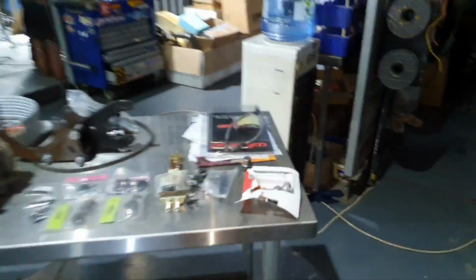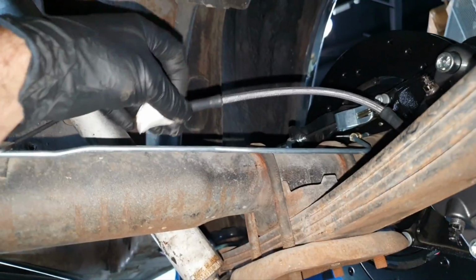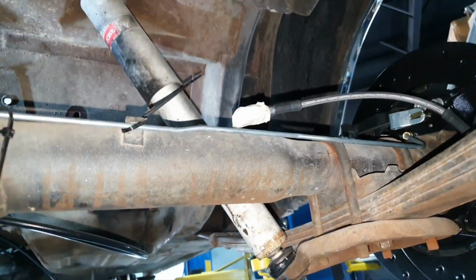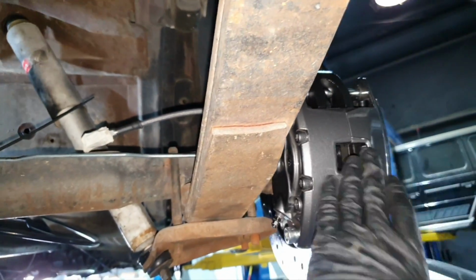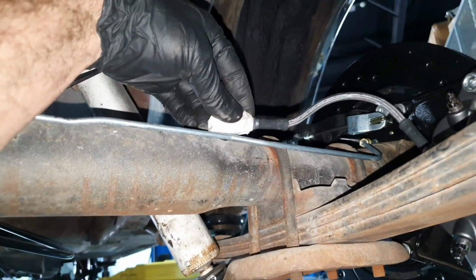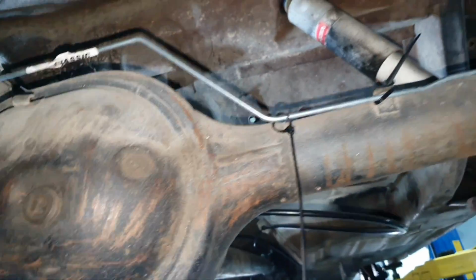It's not the brake shoes, it's a brake caliper. Yeah, no, the flexible here, because otherwise if you want to change the brake pads, you have to remove the brake line all the time. So it needs to be calculated also how much back it has to come to change the brake pads. So it's not gonna be exactly there, it needs to have some space, let us say, to come somewhere there to be able to remove it and change the brake pads, right? Don't be on the limit.